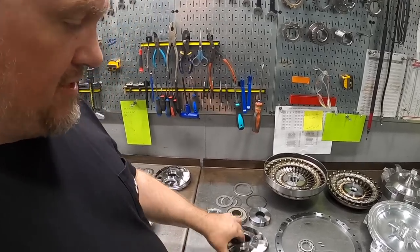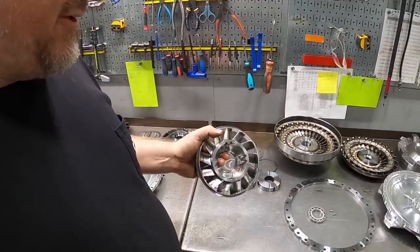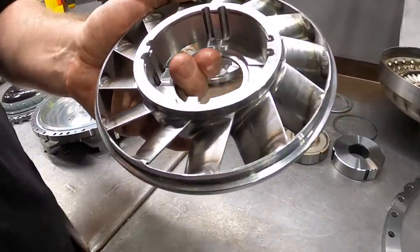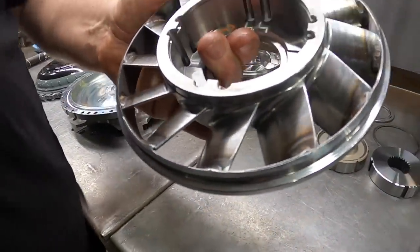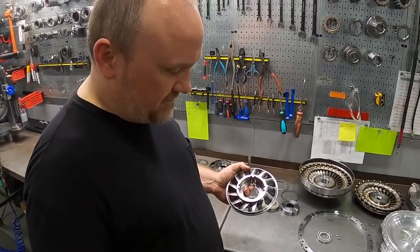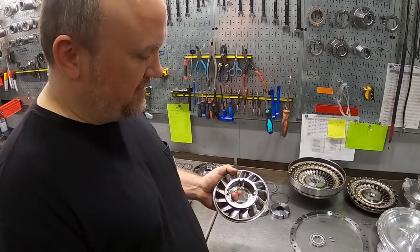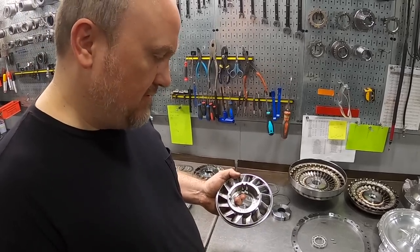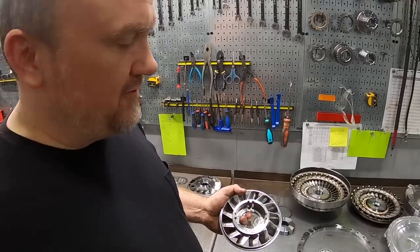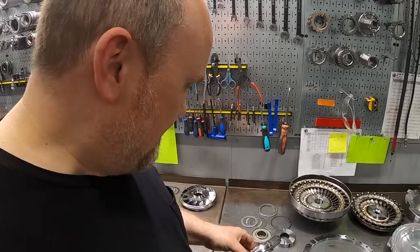Of course, the stator is still pretty conventional construction as far as stators go, but these are unique airfoil blade designs that are unique to Circle D Specialties. Rather than having conventional fabricated steel stators with flat blades, we like to rely heavily on the airfoil stuff. It gives us a much bigger tuning window with stator technology. We can generate different K-factor profiles with the stator and make the converter do all kinds of different things that you just can't achieve with a flat blade stator.